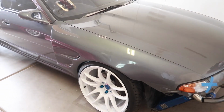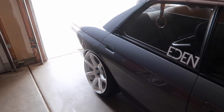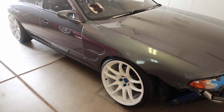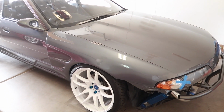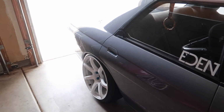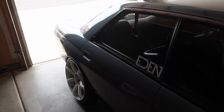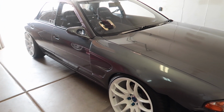We stripped the Skyline down, the paint all the way down to almost bare metal. We filled in any imperfection with Bondo, got that sanded down as well. We added 5 layers of base coat and hit it with 3 layers of clear coat, and it came out amazing. We also added about 40 grams of mixed blue and crystal white pearls. Of course, cameras and pictures do not do justice for their work, but in person, the Skyline is immaculate, and I couldn't be any happier with the results.